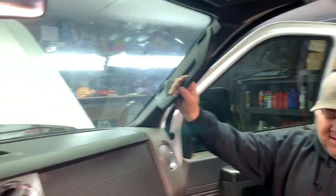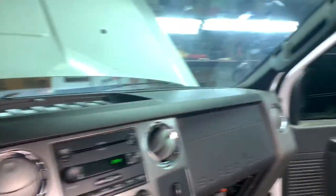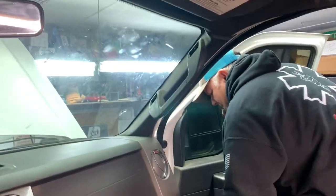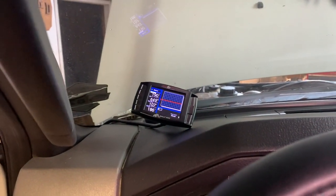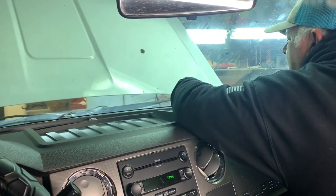While Gary's been doing his side, I already did mine — all done, back together. We're at 186 degrees coolant temp, oil temp at 190. She's warmed up. I'm going to take her for a spin in a minute and check back in with y'all.